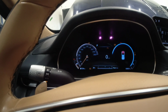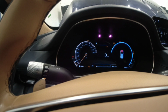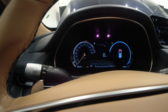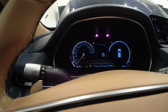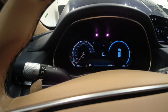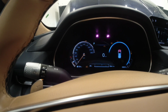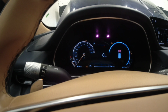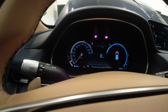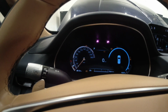Hey guys, welcome back again. We're continuing this GV80 with the ABS module issue. I just finished putting a new one in. Because that part is back order again, and this is a very special customer, my boss told me to grab a new one from another vehicle. So I took it out and put it on this problem vehicle. Before, as you can see, we didn't have that warning message, stop vehicle and this and that, right? It's just warning lights there.